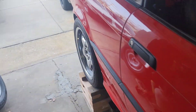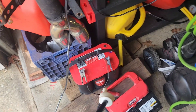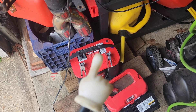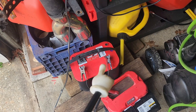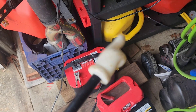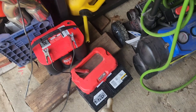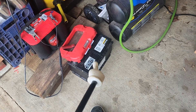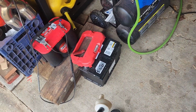I also got a new battery — I spent the money and got an Optima Red Top. They're good batteries. I had these on my Subaru back in the day and literally went to Iraq for a year, left it sitting with the battery disconnected with a circuit breaker in the trunk. When I got home after a year I pushed the button on the circuit breaker, turned the key, and that car started right up. I got it because I like them and think they're worth the money. This old one went down to 6 volts twice and won't charge past 6 volts — it's one of those DieHard Gold ones from AutoZone. I'm going to take that back for core.